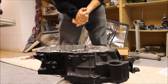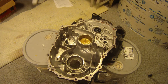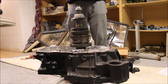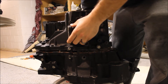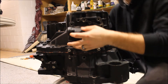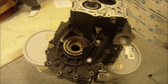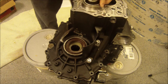Once you get everything clean, starting from scratch, you're supposed to take the output shaft and put that in the transmission all by itself. Then you put the case on. I'm not going to do all of this, I'm just showing you what you're supposed to do. Line all the dowels up, draw it in flat, use little bolts or whatever, torque it. Then you take the brace, tap that in, not all the way down, but just so it's in.